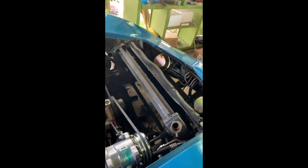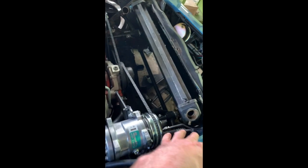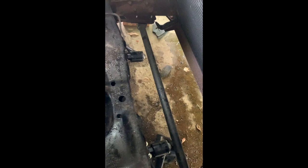I couldn't get the radiator to come out at all initially after removing the shroud and hoses. What happened is it rusted to the pan it sits on. I used a mallet to loosen it, then put a tire jack underneath it — being very careful just to touch the radiator — and popped it up a couple times. It's nice and loose now. The bottom isn't too bad, just some surface rust, nothing critical. I'm degreasing it now and then I'll put some rust treatment on it.